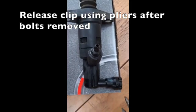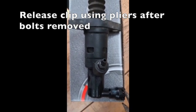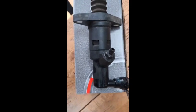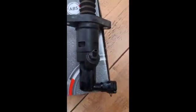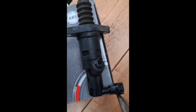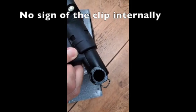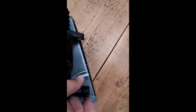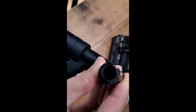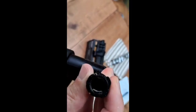It's a bit difficult to show with one hand, but the idea is you get one part of your pliers on the clip and the other on the head, and it pops. When it's in situ you won't be able to access the underside, so from the top grab hold of it and just pull it through — that opens it up enough for the hose to be free. If you pop it back in place, it pushes down and clamps around the hose.